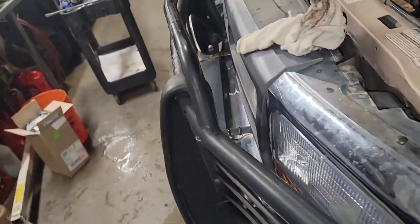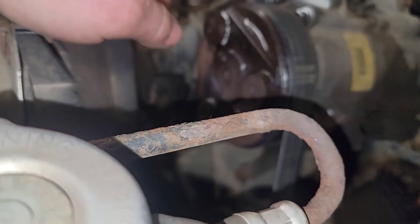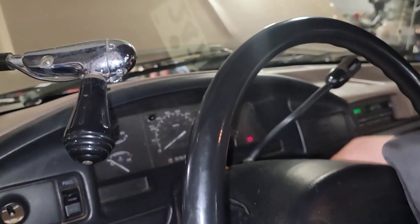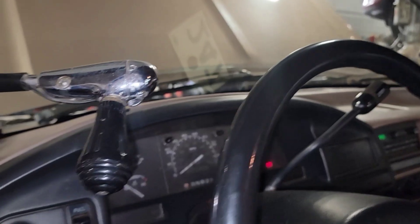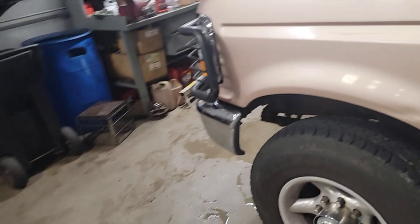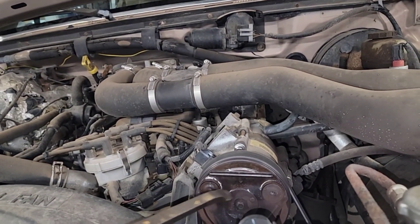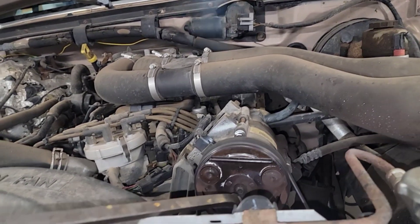What was making the noise was the clutch - it's collapsed on the face and it's jarring around making all kinds of noise when you start it. I'll start it up for you real quick. It fires right up - and there you can hear it, collapsed.